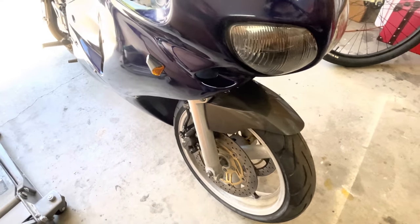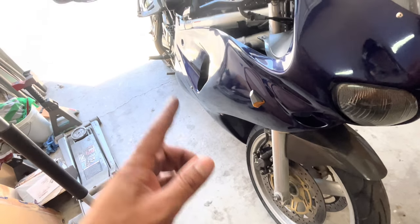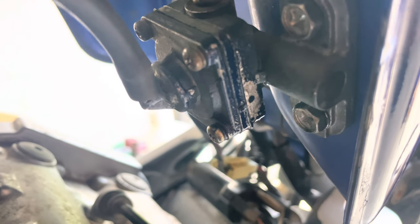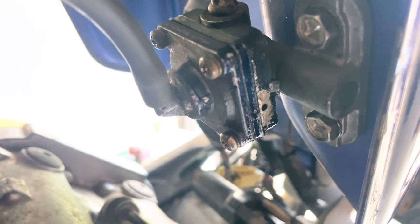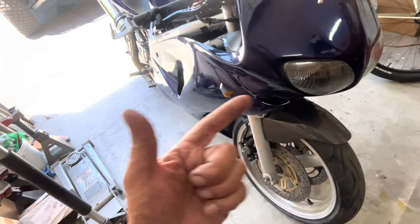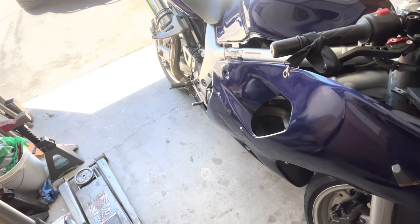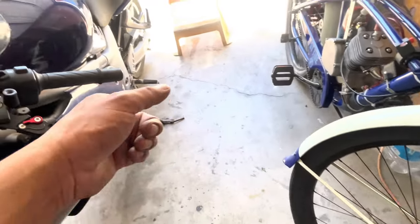That's that for the brakes. I did ride the bike about a hundred yards back and forth, but the petcock is done. It's kind of hard to see, but fuel is coming out of that little hole, which means the diaphragm of the petcock is bad. I was basically mixing and matching parts from the Amazon one and it just didn't work, so I gotta drain the tank again and change the petcock. Hopefully this is the last time because I'm getting sick of it.